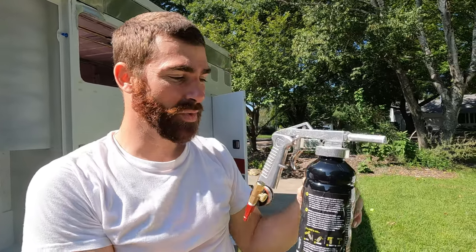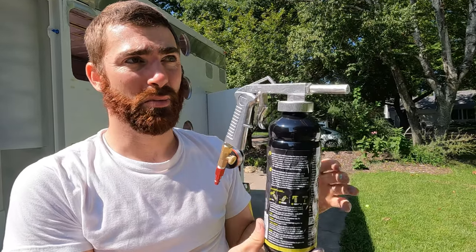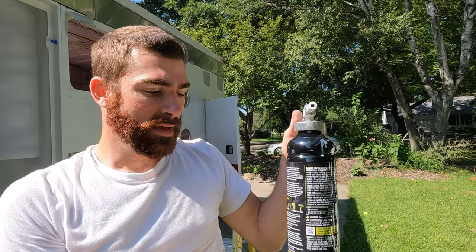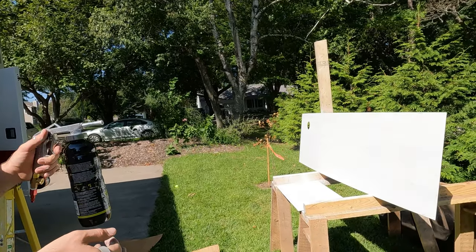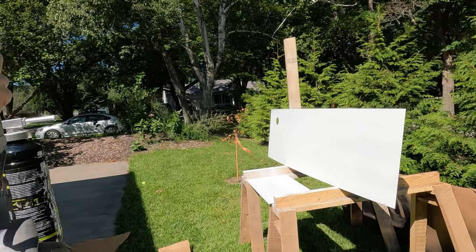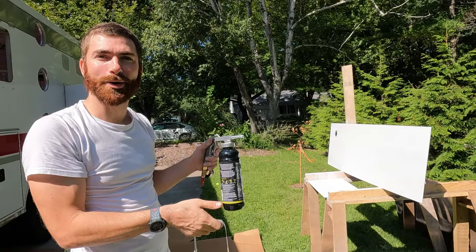As you can see, I'm using a different gun. What happened I still don't know — it just didn't spray well, almost no volume came out. Although it was thinned to the recommended 20%, I don't have an explanation. So we are now spraying at 90 PSI straight out of this gun with about a 10% reduction. It's working well. These are the results from the first bottle — we just did a quick thin layer. At 90 PSI it leaves very small truck bed lining marks, so it's nice.